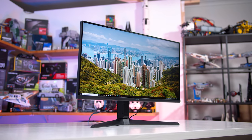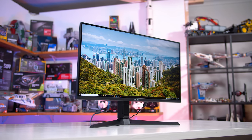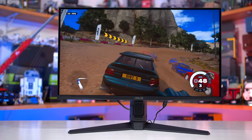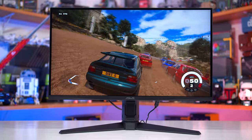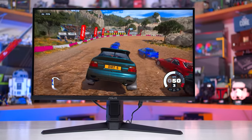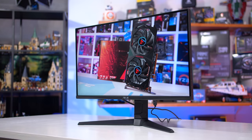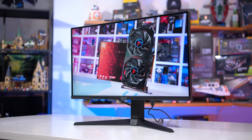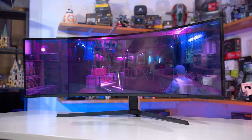For example, this 4K 144Hz monitor here — HDMI 2.0 can't run it at 144Hz so you need HDMI 2.1, but DisplayPort 1.4 can run it at 144Hz no problem with DSC. Some people say DSC is potentially inferior, but it's meant to be a lossless compression technology, or very close to lossless, so you don't see any issues with that.